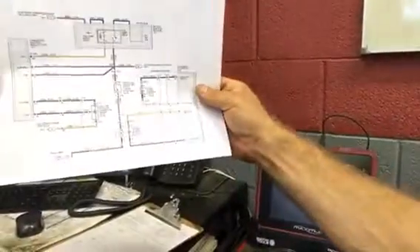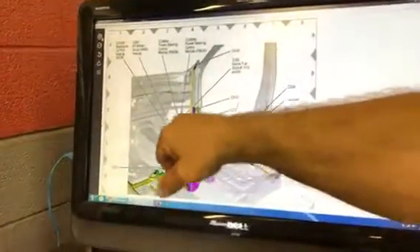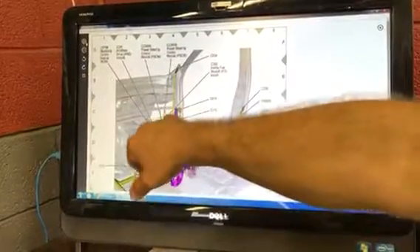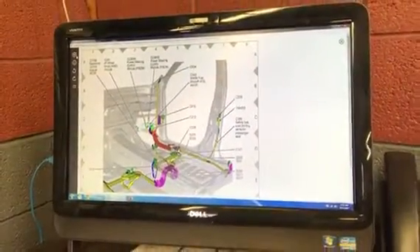Just to give you an idea of where we're looking at here, let's take a look at the actual circuit. We'll bring it down and have you kind of hold that up so you can see exactly the circuit that we're trying to follow. Here's an indication of the components and where we have to work. This is the inertia switch right here. What happens in a rollover situation — the switch will basically shut power to the fuel pump, as you can see in this circuit.